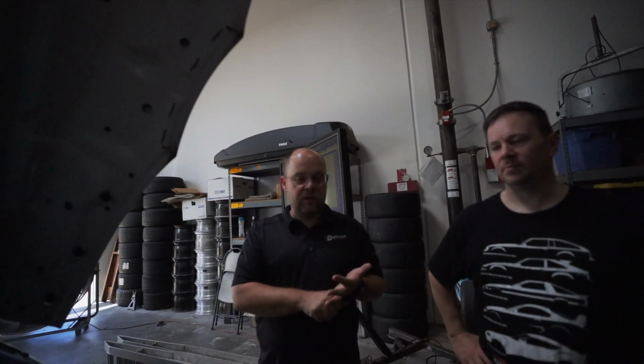All right, guys, we're here at Delicious Tuning. We've installed the power plug, and we're going to let Bill explain some of the features and benefits of the style that we decided to do this plug-in. So yeah, we decided to do a Bluetooth connection to it through an Android app or an Apple app. The Apple app's going to be out by the time you see this video. So you can switch between different modes on there. We're going to have a Valet Mode, a Stage 1 mode for 91 octane, one for 93 plus octane, and one probably for a race gas map.